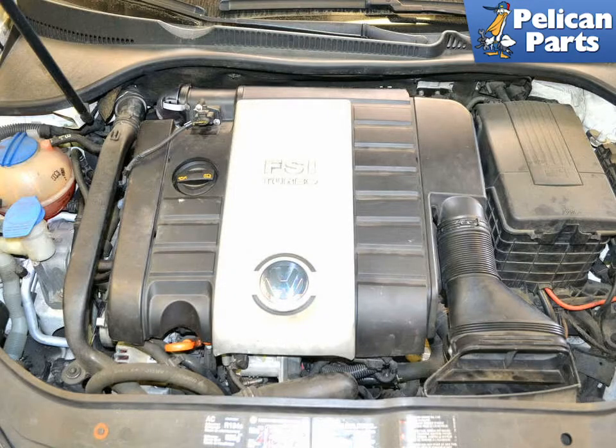You're going to need to remove the engine covers and any aftermarket air induction system. It's also a good idea to label and remove your evap lines at this time to give you more room to work. For additional assistance with those tasks, please follow the link provided at the end of this video.